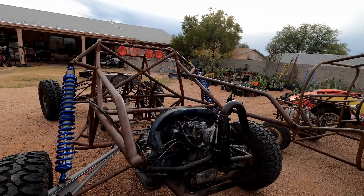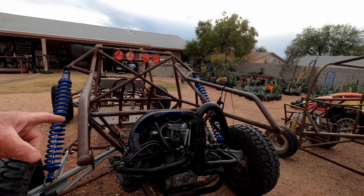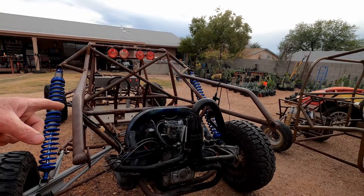So it's like okay, this thing's close to running — but then the coil started getting super hot. It actually burned up. It got so hot that it changed color, and I'm like what in the heck is going on. I ended up returning that coil. I did a little research on the internet — what would make a coil burn up? They say faulty wires or a plug can throw the juice back into the coil and burn it up. But it was a brand new coil, had it in the car for five minutes, and it burned my finger. I mean, the thing just burned up, it was crazy.